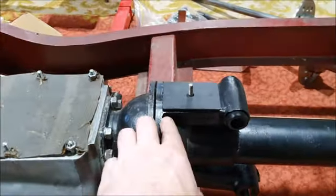That's one of those things I could cut on the laser cutter. And apparently there's meant to be a felt that goes in here that controls the rate of oil flow through this hole, because otherwise you would just fill this with oil and it's just going to pour out. So there's some sort of felt block that goes inside there.